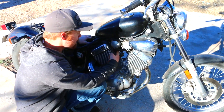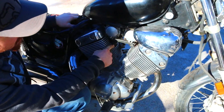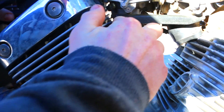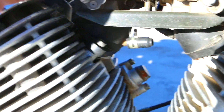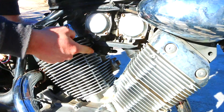Today I'm going to show you how I diagnose bad intake manifolds on a bike. These little guys here are the intake manifolds. The way I tell if they're bad or not is any cracks in them that go all the way through means they're bad. Because what happens is it sucks in more air and messes with the carburation. You want this to be very sealed all the way through.